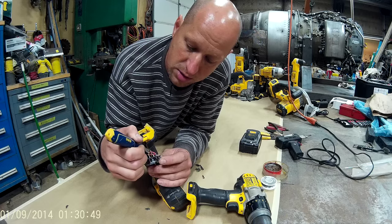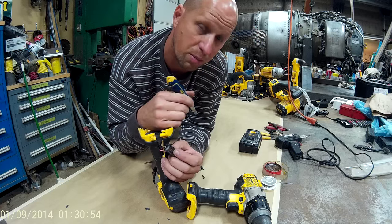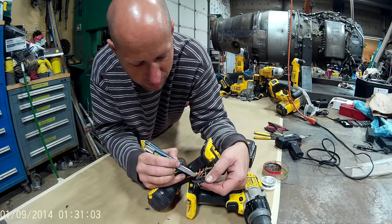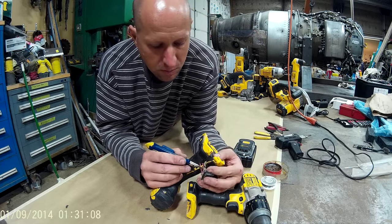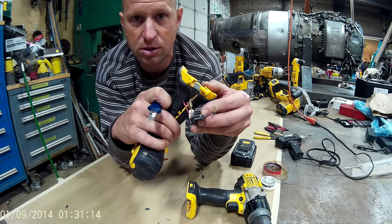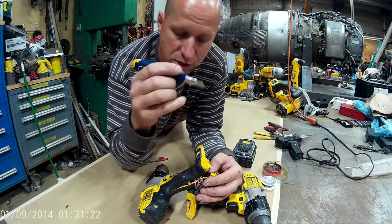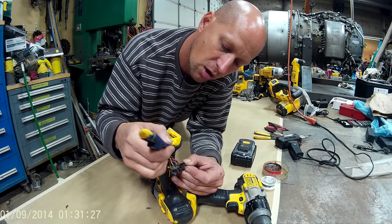Now this one's made a liar out of me because it looks like it is still okay. So the problem with these two drills may just be the one pack — it may be that the terminals in the pack are dirty and not letting it work. But let's proceed as if this is broken. Why doesn't it happen to the big wires, the ones that carry all the power? If you look at these here, these are not soldered but rather welded to those terminals. But the other two, the smaller ones, are stripped, sent through the hole, back around each other, a little flux and solder — and that's what causes the problem, the wire gets hard right there at the bottom.